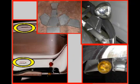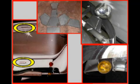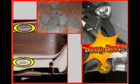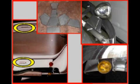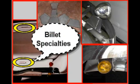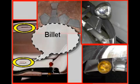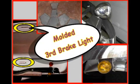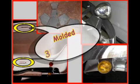Ford cowl lights were converted into rear running, turn, and stop lights. The multi-angle bracket was plasma cut from stainless, MIG welded, ground, and polished. 55-watt fog backup lights were attached to the bracket below the rear bumper. A beeper horn is also activated when in reverse, since vision is minimal out of the rear window. A special circuit was used so the horn does not beep when only the fog lights are needed. The lower circle in the photo shows a Billet Specialties license plate frame used as a running and third brake light; the upper circle is a third brake light molded into the body — to be sure folks knew the car was stopping.